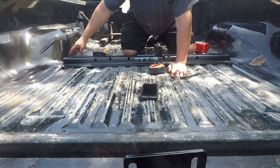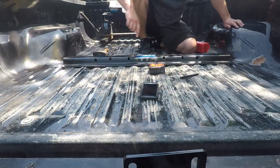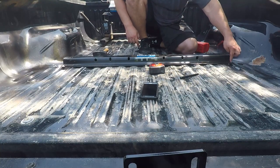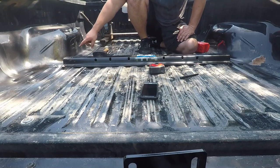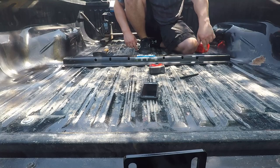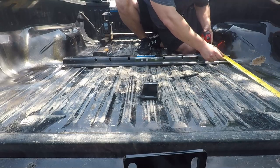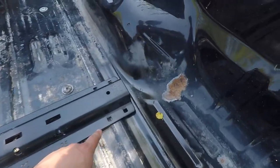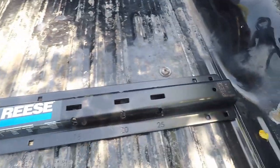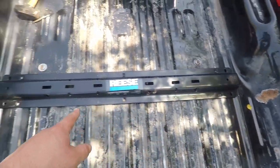This is three-quarters of an inch here. There's almost exactly a half inch between this and the weld seam — a half inch from there to the bracket. I did front and rear on each side, then checked one more time to make sure we're right at 27 and five-eighths on the bracket. We have this lined up, half inch off the edge, and I have checked this multiple times.